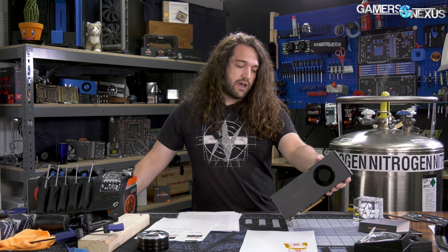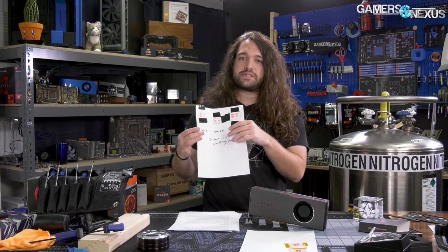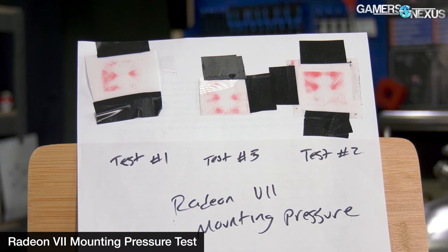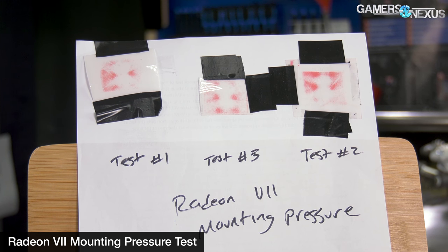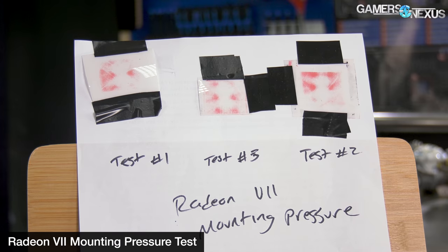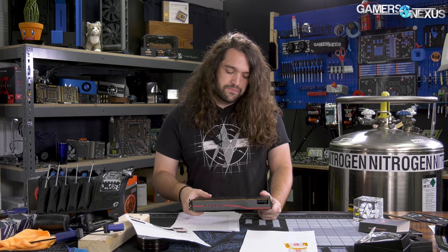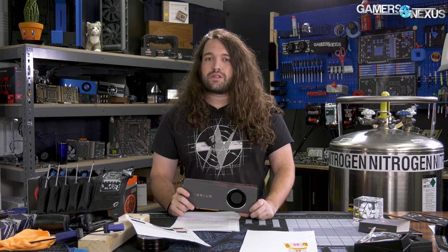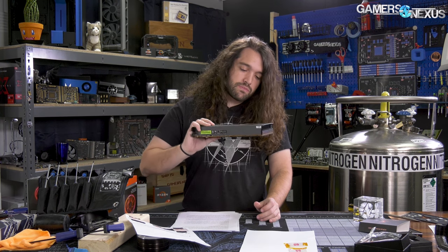The point is we put some of those on with Radeon 7 and we were able to get paste working, where previously when we installed Radeon 7 with thermal paste and without any extra mounting pressure from washers under the four screws on the retention plate, it made worse contact than the HM03. And so the HM03 thermal pad was better in those scenarios, but with the extra mounting pressure, the thermal paste is better. So we applied that here too, and we've improved it quite a bit for just the blower cooler alone, to the point where we can now run at a lower noise level while operating at slightly lower temperatures as well and no longer throttle. Previously we were thermal throttling on the frequency at 40 dBA, and we've now fixed that.